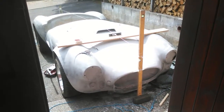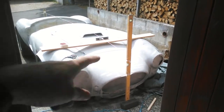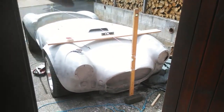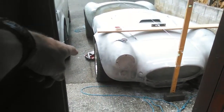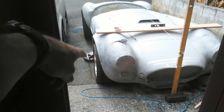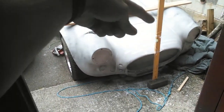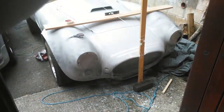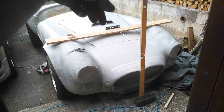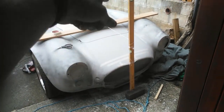Here we are trying to find the center of the car. I've got a spirit level up the front, which is 90 degrees to the horizontal - that's what the piece of wood is for. I had to jack the car up to get it horizontal, and the piece of wood is an equal distance up the wing on both sides with a small spirit level on it.